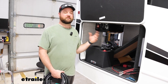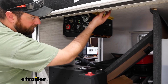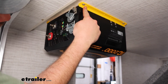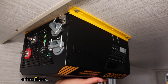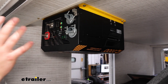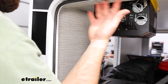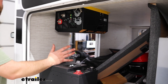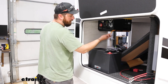Now we've got our solar panels secured on the roof and can start working on the wiring for our inverter and converter. We've got ours mounted up on the ceiling of this compartment — we had a solid sheet of plywood above so we just used wood screws. The best way to do this is to mark out the larger section of the hole, hold it up or use a template, get your screw started, have a friend help you lift it, slide it over those screws and lock it in place, then screw down tight. You can mount this in any orientation — you just want to be sure you are eight inches away from everything on all sides, including keeping stored items at least eight inches away.